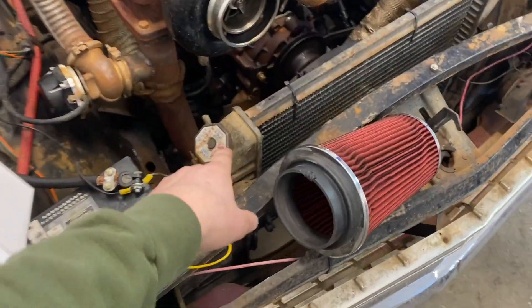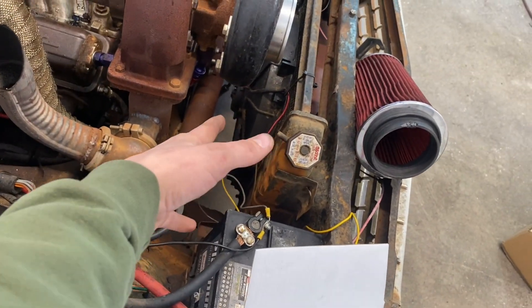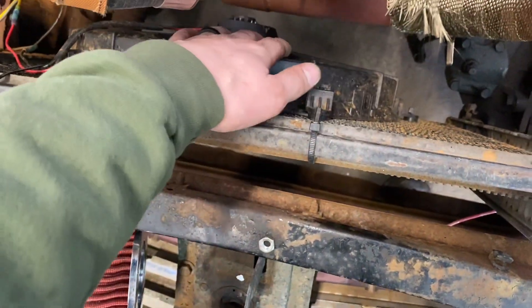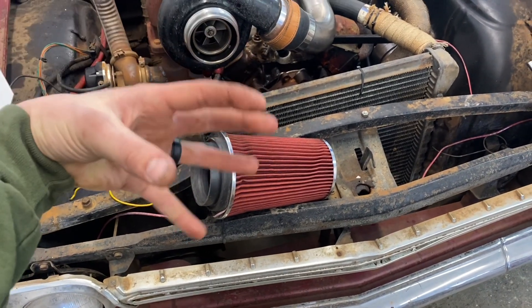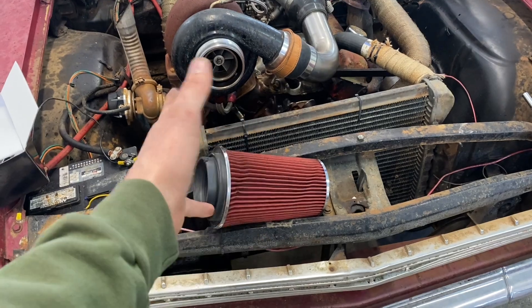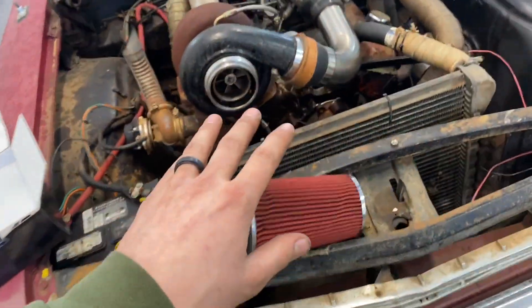The cooling system is horrible. This is a factory radiator from Jordan's '69 Camaro, so that's going back to Jordan. It's just got this one single fan zip tied to it. Without an actual shroud going around the fan and the radiator, the fan only pulls through one spot and you're only using about 30% of the radiator. So what I got is a big aluminum radiator with a shroud and dual fans — that should keep this thing cool and hopefully we won't have any heating issues anymore.